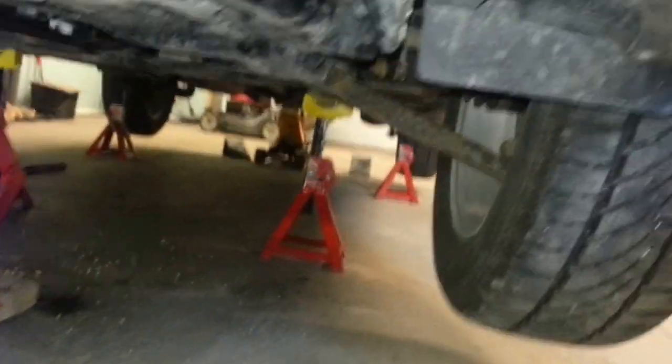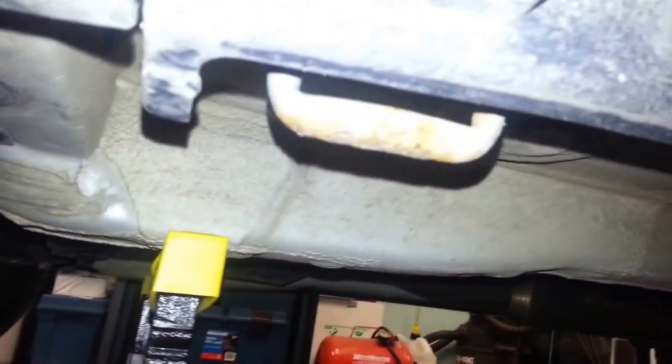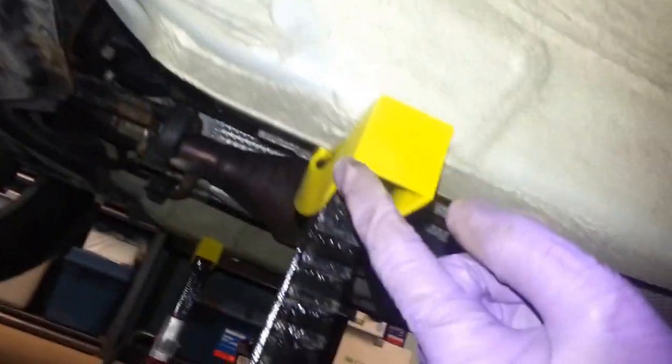And then for the jack stand placements, so this is the front of the car. It's actually not here. This is only for the jack. If you're changing a spare tire, it's actually not here. This is not an authorized front lifting point, even if you're on a post hoist or using jack stands. It's actually right here. If you read in the manual, they actually mark it. I think it's right here, not there, right here. You can see where my jack stand made a mark there. What I actually did is I put it on the frame right here. That's just a protector right there. So that's where I put mine. So you should probably follow the factory one there, but I don't really like that, so I just put mine over there.